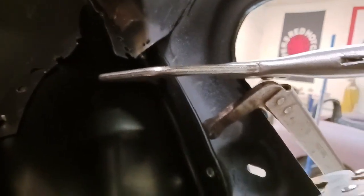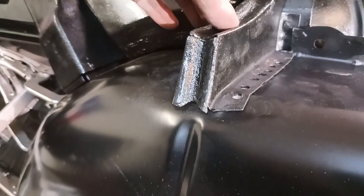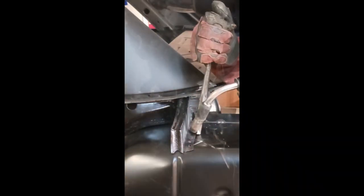I've got the C-clamps into place — we always want to have everything really sandwiched nice and tight, we don't want to be sloppy. Getting a good, nice, tight fit using the porta-power to keep some upward pressure so we don't have a bunch of gaps. That's our little support there — time to weld, let's get this thing welded into place.